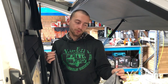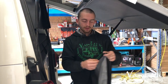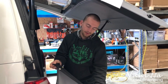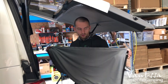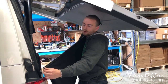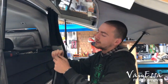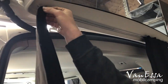Now we do the left side curtain. This is the edge that has no studs; the other side has studs on the left side. The grey one faces toward the front of the vehicle and the black one faces toward the rear of the vehicle. Then we start feeding the curtain into the rail.